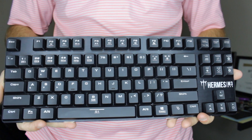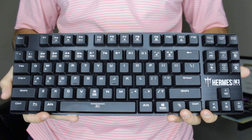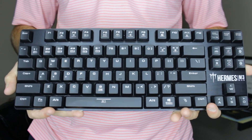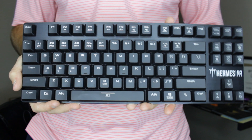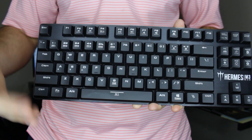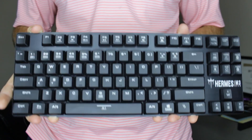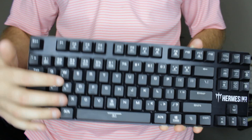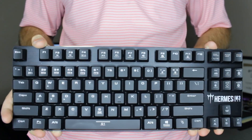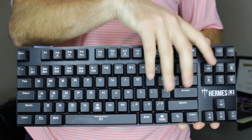So this is a closer look at the keyboard itself. This is an 87-key keyboard and like I said, it is low profile, so the key caps are a little different. In terms of key strokes, you're supposed to be able to get a longer lifetime out of these with 60 million strokes. Instead of an 11.5mm diameter, they have an 8.5mm diameter, and the travel time between the key and actually hitting the switch is less — so you could say it's a little bit more responsive. I personally prefer a smaller, more portable keyboard like this.